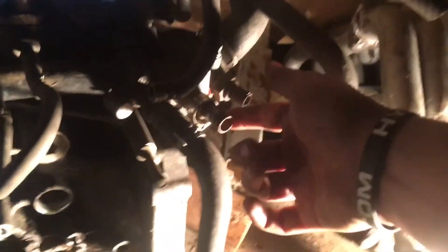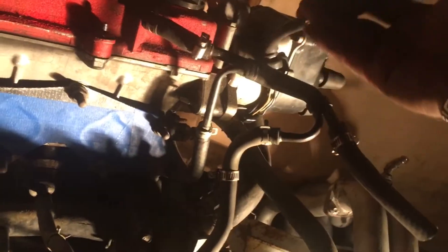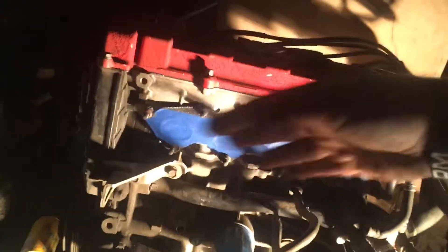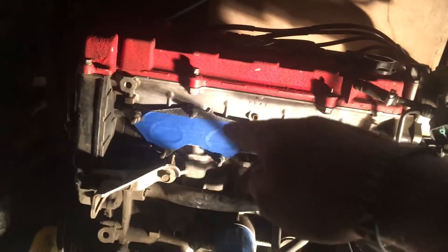I'm going to be blocking this off, blocking that off. This plug — I'm not going to be using this because this is OBD0. Like the oil pressure sensor, those are all going to be taped off and squared away, along with the other side. Now when it comes to the header side of the motor, I'm not going to do anything to it really, because there's no sensors in the front. The headers are already on it, so there's not going to be any water that gets in.